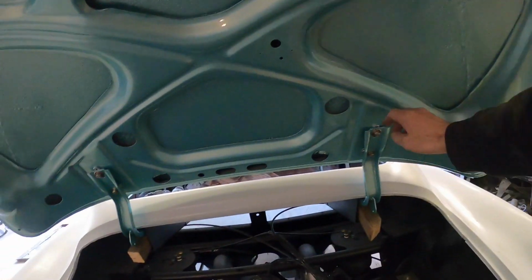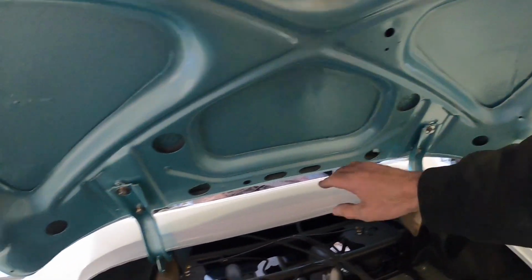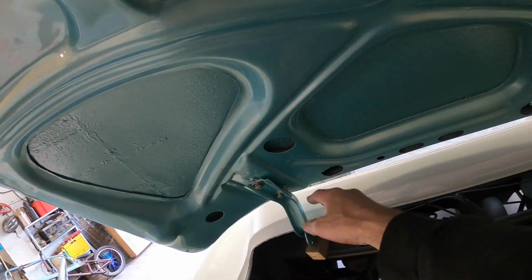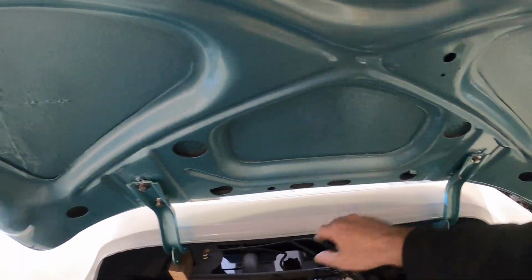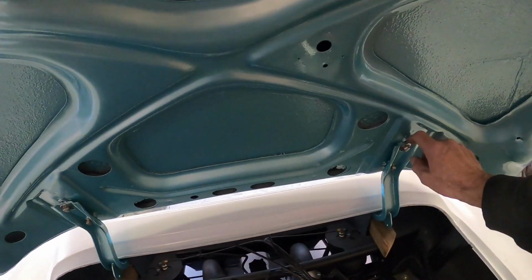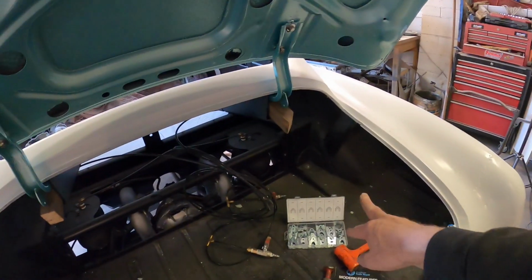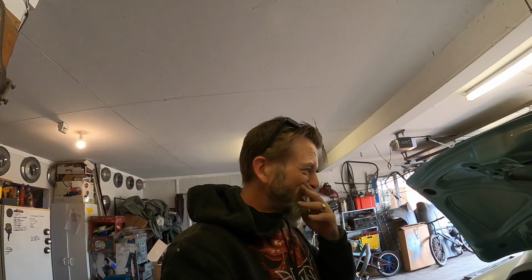Okay, so got a few shims in there from my shim kit, which worked out quite good. They're a bit wonky, but don't worry about that. So we've got a couple of 1/8 inch at the backs on that side, not quite the same amount on this side, and then an 1/8 and just an 1/8 there, and an 1/8 and a 1/32 at the front on that one. Just tried different things to get it all level up. It never did level up that well before.